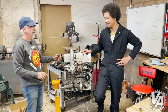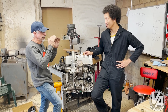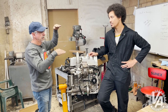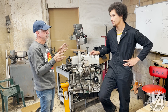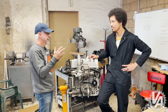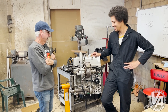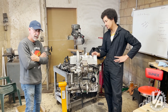I have a manual transmission and a first-gen CRV. We could put it in there so we can finish up that kit too, because it's actually slightly different than an EK kit. People using the subframe — the subframe is actually slightly lower in relationship to the frame rails. So if you're using an EK K1 kit to do a K-swap in your CRV, you should put about a four-tenths inch spacer underneath the rear mount and it works fine. We'll just make a new rear bracket or side brackets. There's a lot of room above that, so we might even go to a top-mount intercooler, which would mean using the stock intake manifold since it feeds on top.